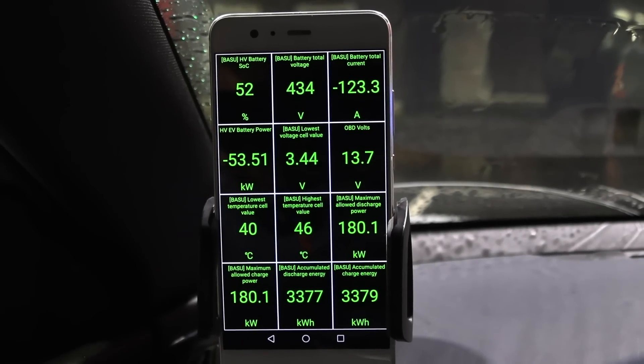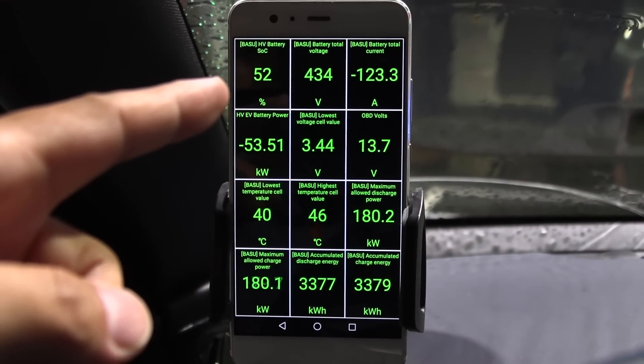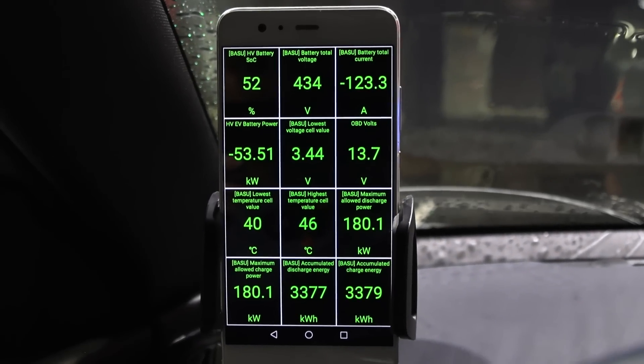I charged to 50%, battery at 44 degrees — same as last time. This time when I start the car I will lower the temperature to maybe 18 degrees, near the lowest setting. And this time we don't get any moisture problem, simply because the air conditioning is cooling down the cabin and also getting rid of the moisture. But how does it affect the battery temperature? We're getting close to Yassim and — wow — on the previous run it was 39 degrees and didn't go below 39. Now we already have 36 degrees and we're not even halfway through the loop. Let's finish the loop. We'll drive the exact same route to the turnaround point and see how much colder the battery is. We're back at the charger. This time we arrived with the same low temp but a much lower high temp — it was 39 in the previous run, but it was actually hovering at 34 for the longest time, then went up to 35 around 19-20% charge. It throttled at 46 degrees, but last time it throttled at 44% state of charge — this time it throttled at 52%. That's a lot better.